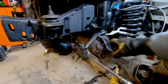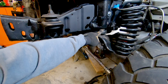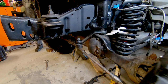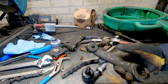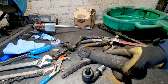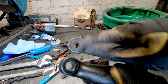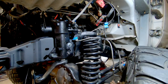There are two things I need to deal with up here. First, when I turn this tire, if I tighten this bolt all the way, the steering arm would actually run into the frame, so I need to clearance the frame a little bit. I've also got another issue unique to me because I'm mixing and matching so many different parts — half my steering's from an F-250, half from an Explorer. This is the stock Pittman arm and this is the drop Pittman arm. Eventually I need to connect all of this to the steering wheel, so a steering shaft will have to come too.